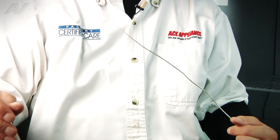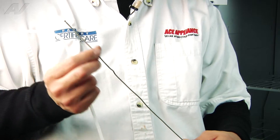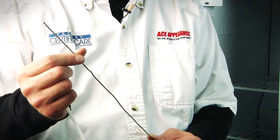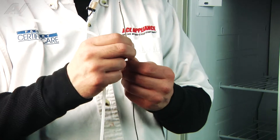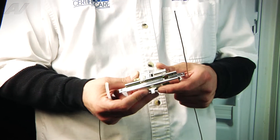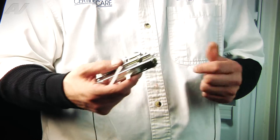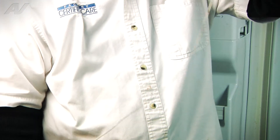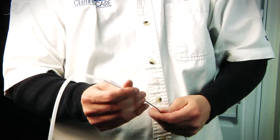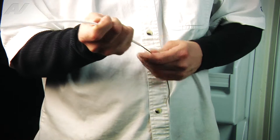What we're going to do is slide this back over the new thermostat and put it back in place. Some people will put a little bit of soap on it if you can't get it back on. So now we have the new thermostat in hand. We're going to take and install the plastic sheath back over the thermostatic bulb. Your thermostat is going to come all wound up — you're going to want to straighten it out. You're just going to start with the end, slide your plastic sheath over, and work to get it back over the new thermostat.